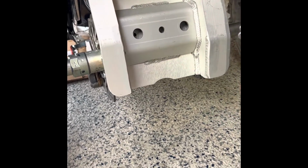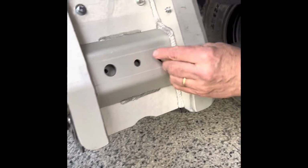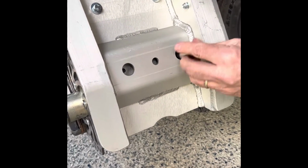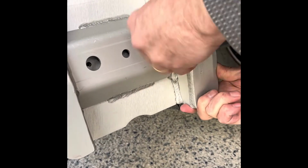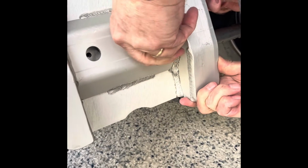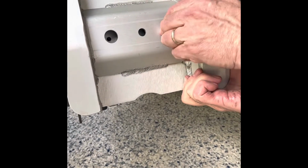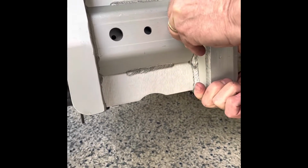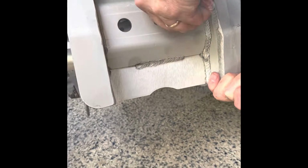So first things first, you want to tip the ATV up on its butt. Make sure you slide something soft under there so you're not scratching up your new rear grab bar. We put a piece of cardboard, and you may ask yourself, can I tip the ATV straight up and not have fluids leak all over the place? The answer is yes. We didn't have any fluid leak anywhere. What I did was put a golf tee inside the hose that connects to the gas cap. If you have the fuel injected model, you'll have no issues. So that's what I did, and it worked really well.